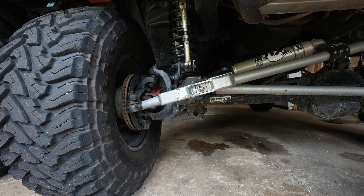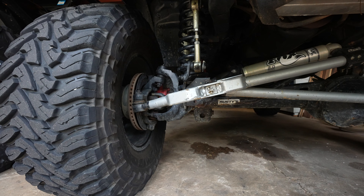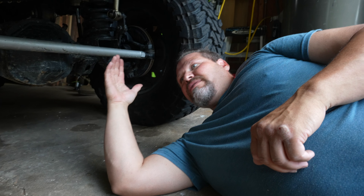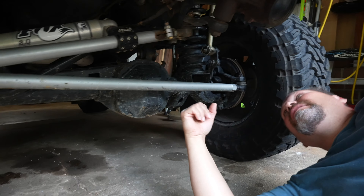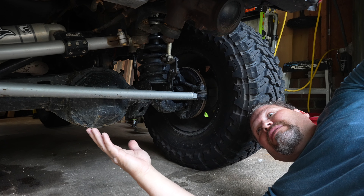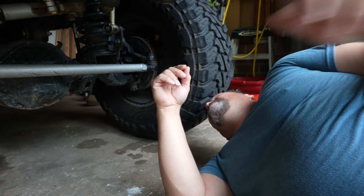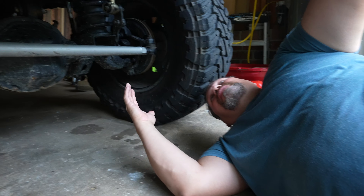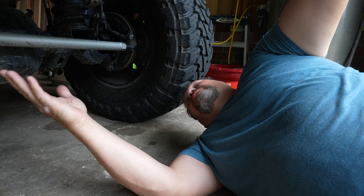The instructions show that you're supposed to set it up that way. If I hit a rock right here, which I do quite often, this thing will get jacked way up. I've learned that you take a crescent wrench to the trail — that's easy. You just get a hold of that and give it a slight bump down. There is a flat spot right there on the tie rod end, so it doesn't move the tie rod end — it just spins it back down. I've got these things on there as tight as I can.